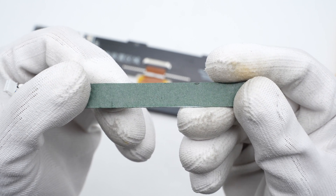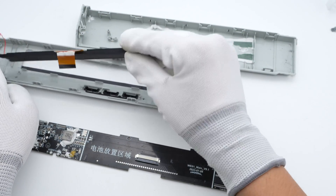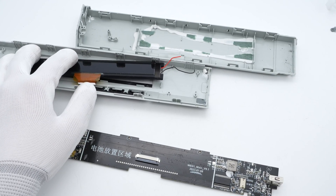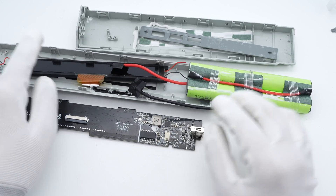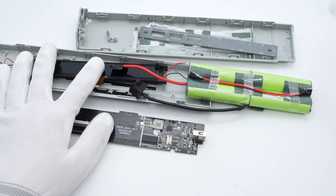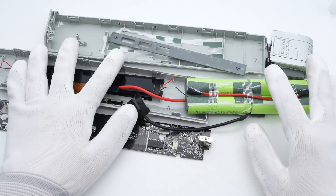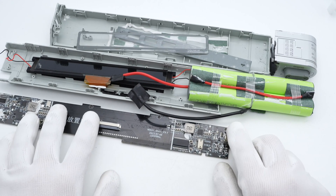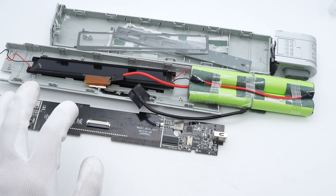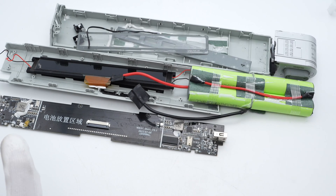Flip to the back — the body paper is used for insulation. That covers all the components of this power bank. After taking it apart, it has two independent circuits with two master control chips, so both USB-C ports can support 20W and the total power can be up to 40W. The battery pack and internal solder joints are reinforced and insulated, making it solid and more durable. The extra built-in USB-C cable allows you to go out without carrying any cables. So, if you are a fan or need a unique power bank, you may consider it.